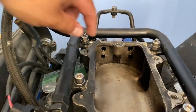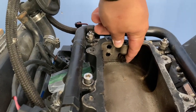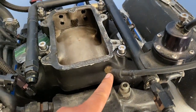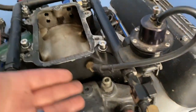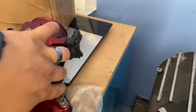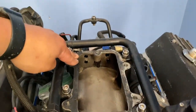As you can see here, I have the air temperature sensor right here, and then multiple other lines. On this one I tapped the fuel pressure regulator to the front, which I'm thinking about doing on this one too so I don't have to run a line all the way to the back. I may even remove the nipple out of this one or reuse one of the ones originally removed from this one, since this one used to have fittings for the cooling lines around the throttle body.